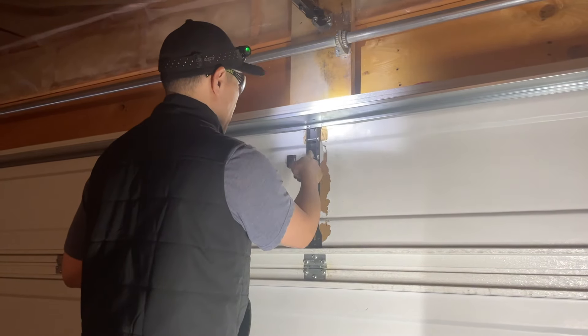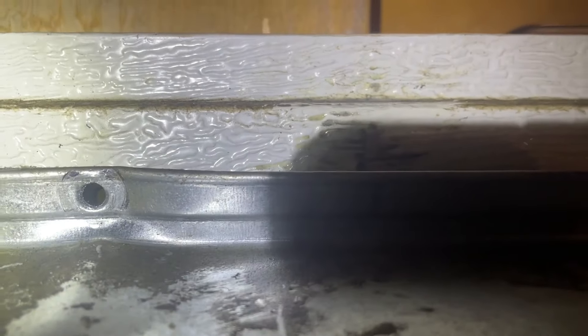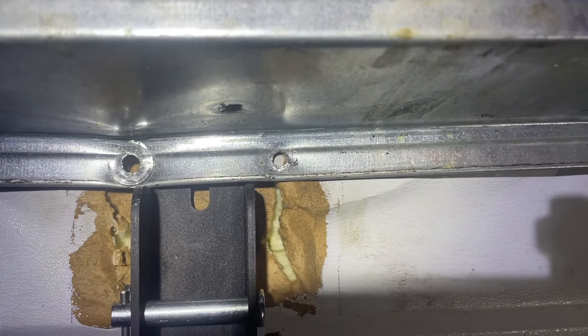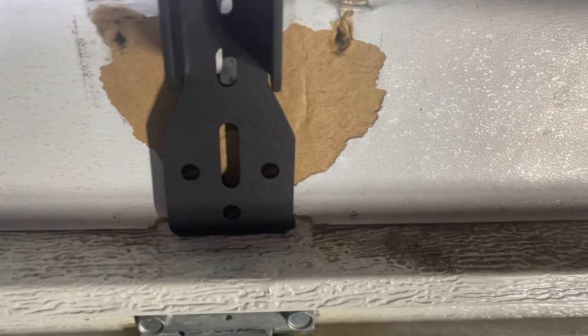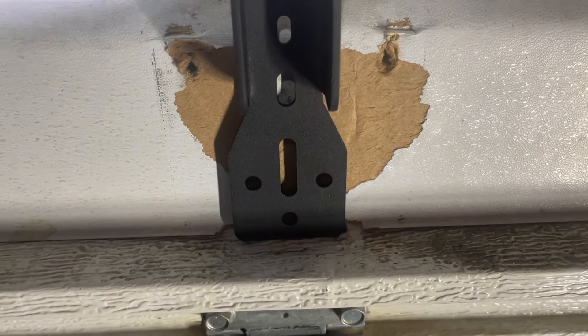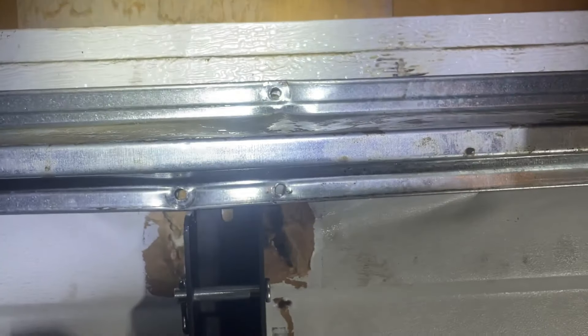After putting this bar back on, looks like the holes are lining up and the bracket is seated underneath properly. I'm going to have to drill a hole up top and one down here. You can see there's a hole that lines up right there, so I'm going to drill that in. Where the bracket is, I'll need to drill a hole through here to reach the screw hole on that bracket — that should help hold this in place on the top. Underneath is still a mess, but we're going to do two new holes. Because this is fiberglass it doesn't really hold well, but down here is where the screws were before — they went in at about a 45-degree angle and actually held pretty well. So we're going to try to bolt this all back in with a couple of bolts on each side.